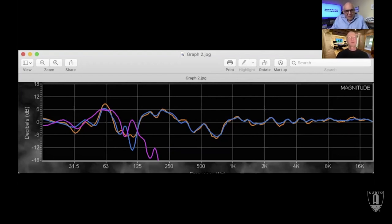You can raise it up. This room had a particular issue at that frequency. Hopefully you won't. But that's the only way. In other words, you could raise the level of the subwoofer right now and fill it in, but then you're going to have problems at 63 hertz, and it's not going to be a perfect solution. So you could move the subwoofer around, and without analyzing software, it's impossible to do. So ultimately you're going to end up getting something that you're comfortable with and you like the sound of. I hate to say it.